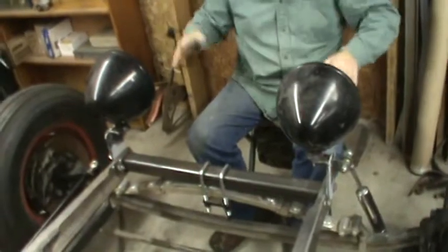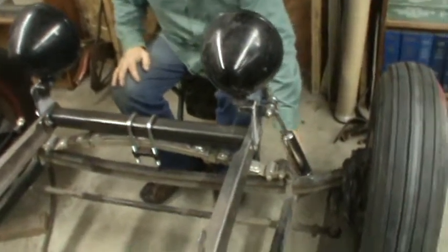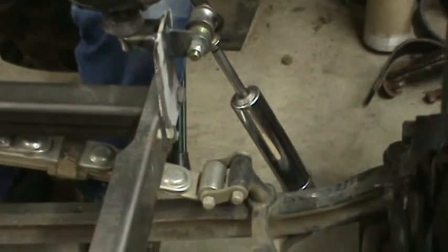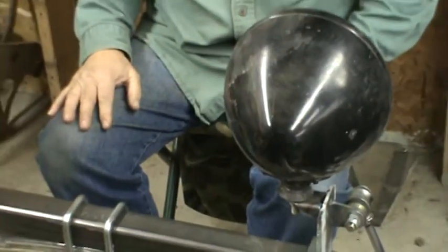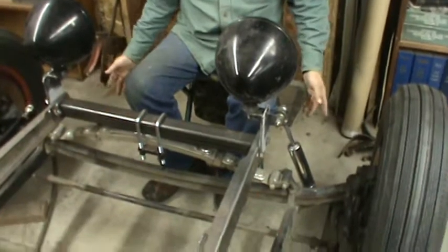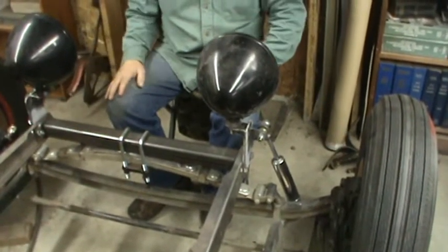The top's inboard, and these are adjustable shocks. They have a little mechanism on the bottom. You turn it with a screwdriver, and they've got clicks like adjusting a scope. You can tighten them up so them shocks are just stiffer than a board, if that's what you want. But about halfway up is about where you're going to need them to keep this thing steady.